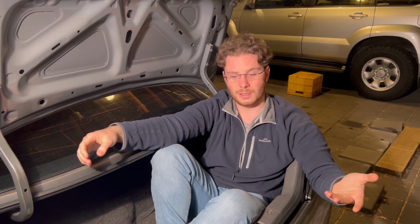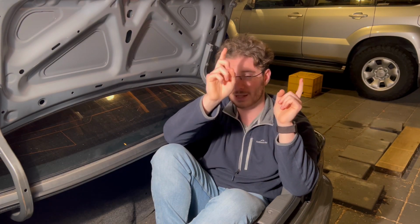And we've run into another problem here. The standard S chassis tail shaft won't bolt onto the Skyline transmission. So what some people do is they retain the Skyline half shaft from the transmission, and then they bolt on a Silvia 200SX tail shaft, or modify the Skyline shaft to mate up with the R200 diff in the back. I believe that's how they do it. Don't quote me on that because that's not what I've done. I've gone for the easy approach, and I've gone for the Alpha Omega single piece aluminium tail shaft. Now that baby is going to run back around $1,000.